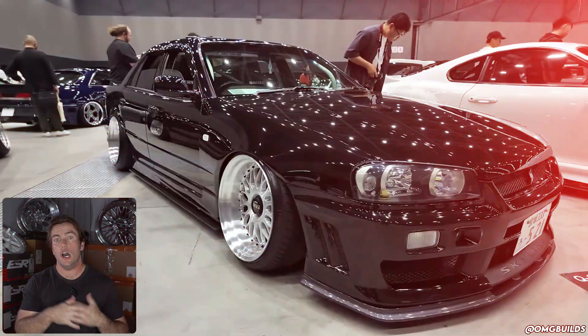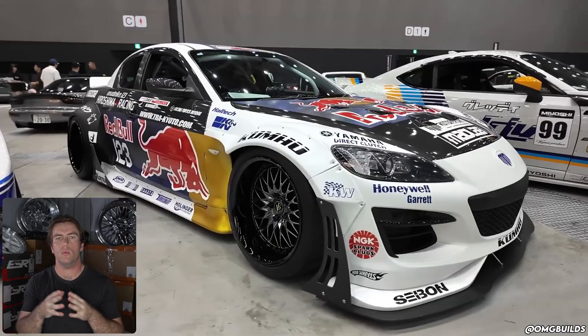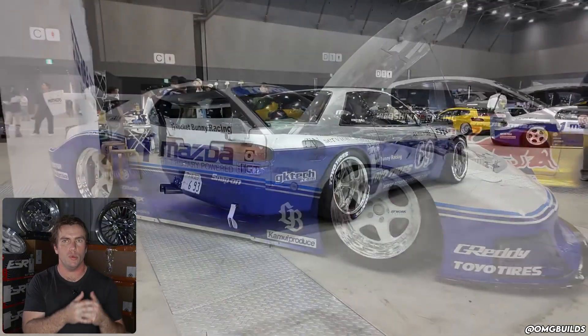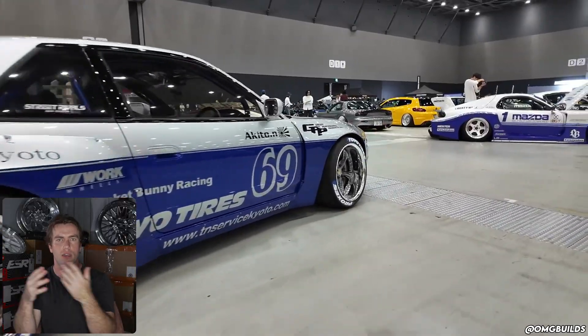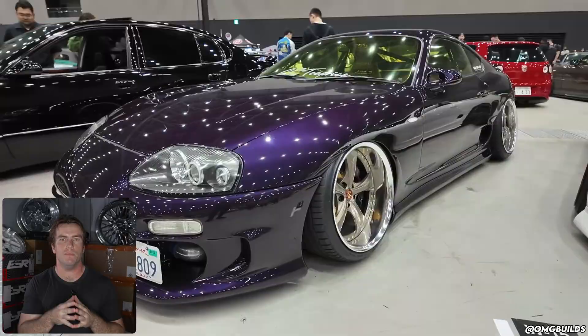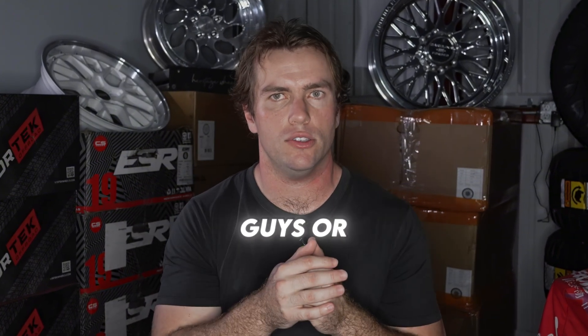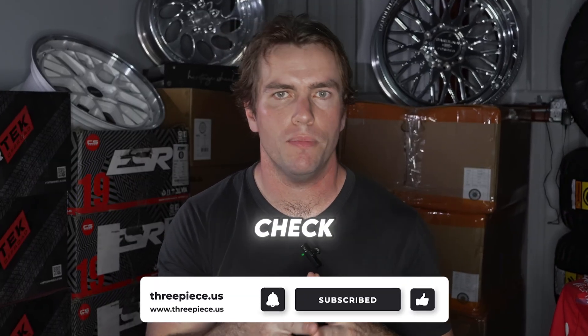The old expression 'measure twice, cut once' is applicable here — it's essentially 'measure ten times, order once.' Wait for the manufacturer to confirm your measurements and give you the actual disc types, because even then it's not possible to be 100% accurate. The good thing is that as long as you land somewhere in the general ballpark, you'll be fine. Needing a 5mm slip-on spacer is not the end of the world, but you want to avoid it — that's why you go with someone experienced in multi-piece wheels. On the flip side, if you blindly order the lowest disc type for maximum lip, you may end up with $4,000 paperweights. We manually check every multi-piece wheel order, so you're going to be good. Before you get to measuring, there's always a chance someone has already run the same wheels with the same brakes on the same vehicle. The wheel manufacturer, forums, our vehicle gallery, and our customer service or sales team are great sources to check. Thanks for watching — if you want more information on multi-piece wheels, drop a comment below.